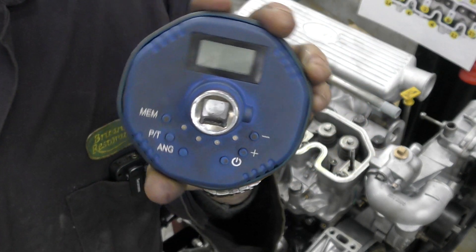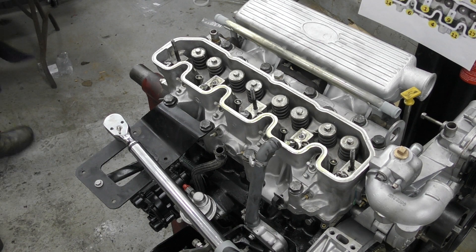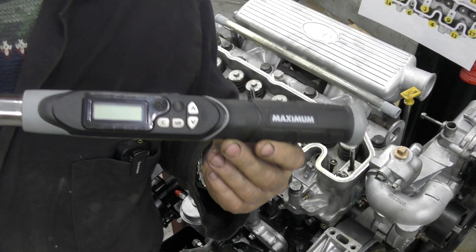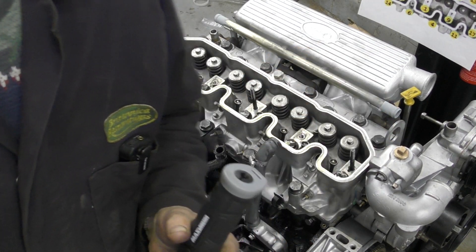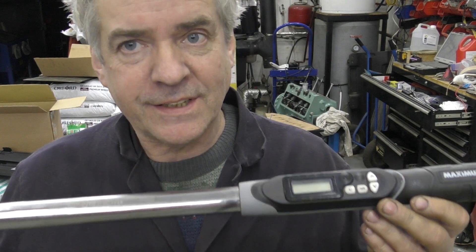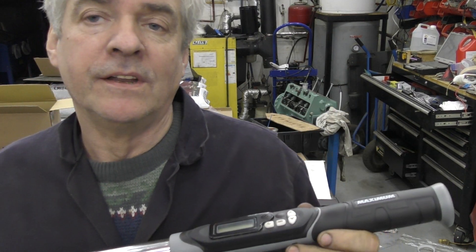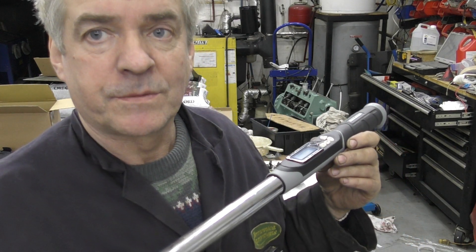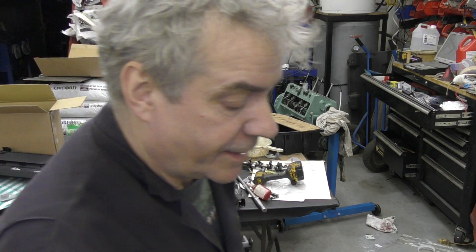The laser tool has served me for a long long time. I had it set at 60 degrees, so when you turn it, it tightens down. But I decided to go into the future with the help of Patrons. I've always said I'd buy myself a new torque wrench, and I did — this Mastercraft one came on special, down from 300 to 250 bucks. I was impressed. It's digital and will do everything those two tools did. I can set it by the number of degrees it turns, flick a button, and continue on to the specified number of degrees like 150 degrees, without moving the tool.